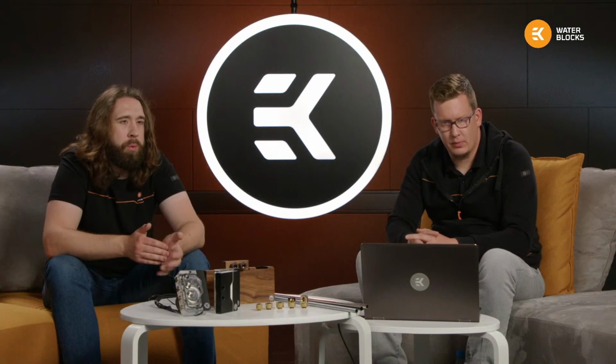at low speed. We also modified the static part of the blade, so the spider on the backside of the fan now has a perfect teardrop shape on the phase fan, and there's also some texture implemented on the surface of the blade. So while we definitely don't expect a massive increase in the static pressure, hopefully it's a lower noise level for the airflow, and the same especially at low speeds.